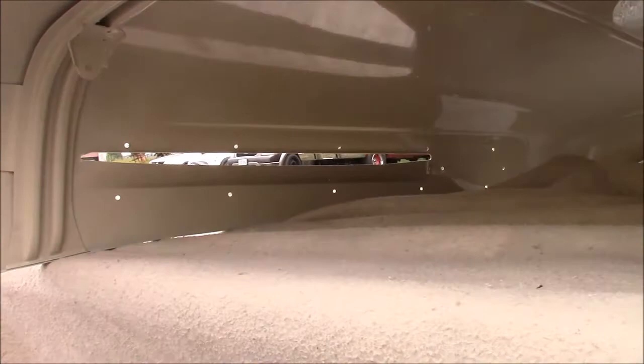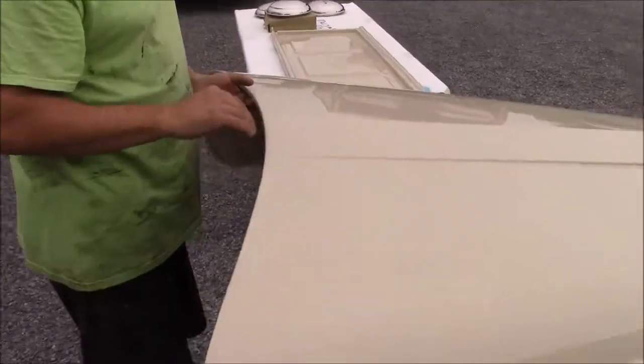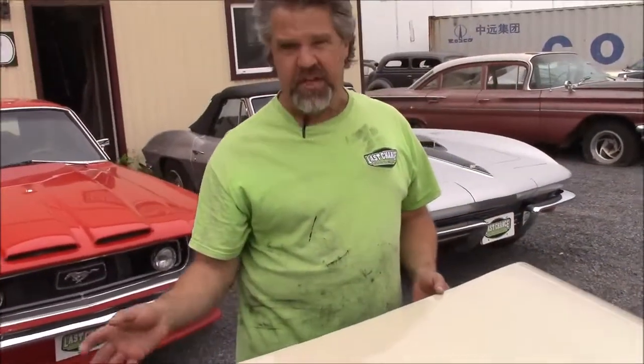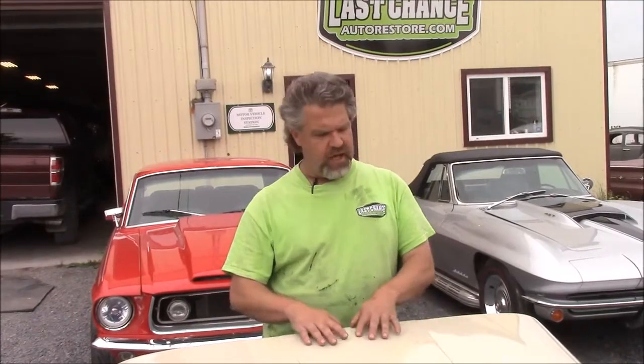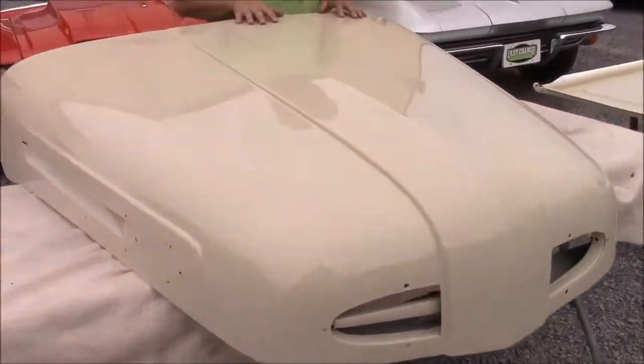A lot of people just like to give the underside a textured look and not do the detail work, but quite frankly it should have a factory-correct look, which is the original paint to both top and bottom. If you recall earlier, when it came from the other shop it had some type of rocker guard asphalt combination product sprayed in black, and it had a lot of areas of bare metal that were rusting and a lot of surface rust. So we eliminated all that, redone this hood both top and bottom, so it basically simulates what it would look like back in 1950 from the factory.